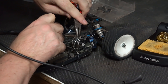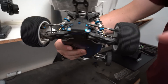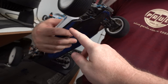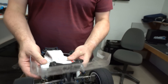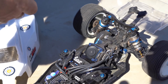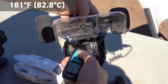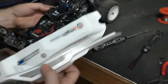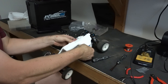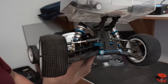To fit the waterfall brace we had to re-solder the motor wires to make room. The waterfall brace with fan was hitting the body a little in the top corners and sticking up slightly, but we rolled with it. Ambient temp was 101 degrees. The microphone was glitching so we turned down the audio, but motor temps reached 181 degrees — the best result so far.